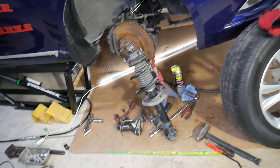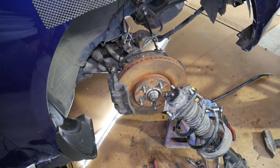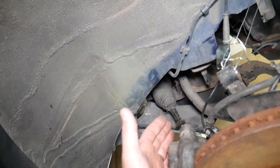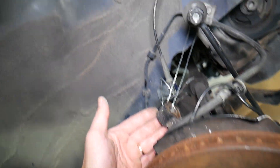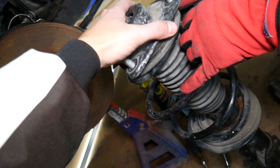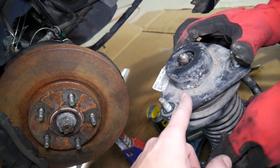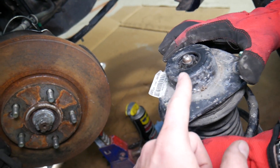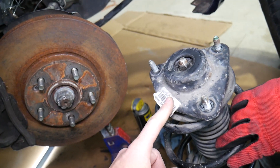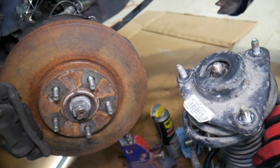We have the strut here removed on the Hyundai so we can explain what we're talking about. What can cause that clunking sound when you steer the wheel? The strut connects the steering knuckle to the body. On top it stays stationary, and on the bottom it will spin and turn. Into that mount you may have bearings and bushings, and when they go bad that can create quite a bit of clunking when you turn the steering wheel. This is very common on higher mileage vehicles.